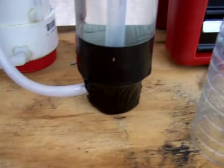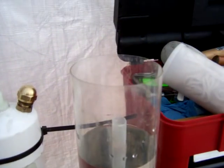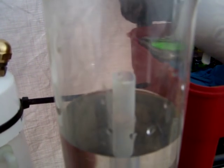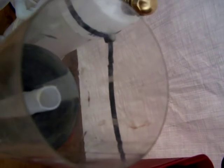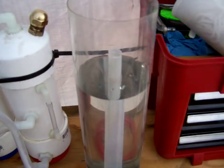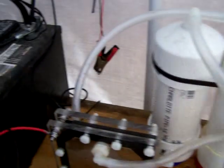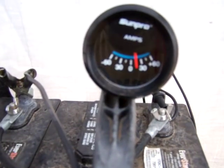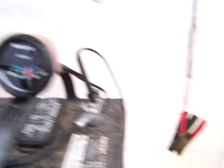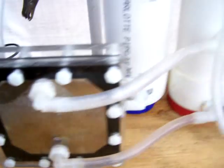You can see it coming down the hose. This little device right here is what's called, jokingly, an H-H-O-ometer. It basically just gauges how much gas you have coming out. You can see that gas coming out of the tube — that is the hydroxy gas, hydrogen and oxygen. So I'm going to measure how quickly this generator runs at just about 15 amps — not pulling that much. I'm pulling about half the power that I would if this was actually hooked into my vehicle.